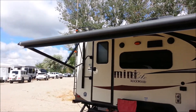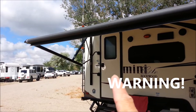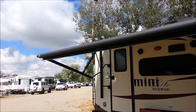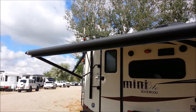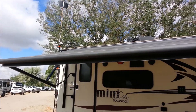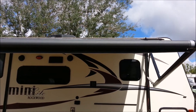Don't forget — if you're going to bring your awning in, come out here and loosen those knobs. Just hold the top with your hand and let it slide out easily. A little tip I thought I'd share, because probably not everybody knows about this, and I doubt if a dealer ever told you anything about it either. Hope that helps out, guys.